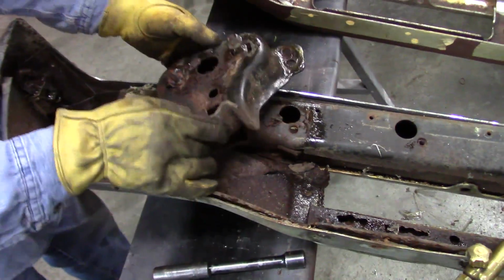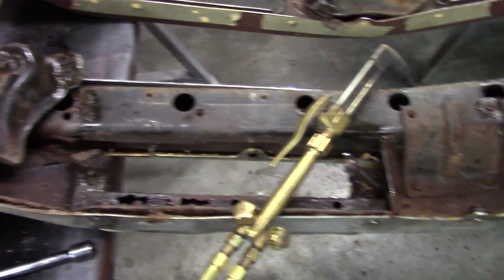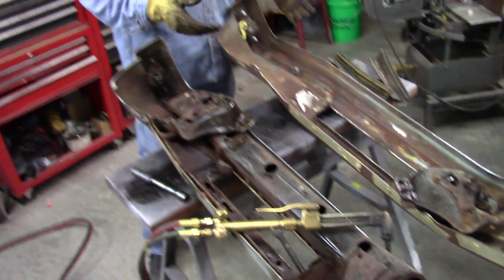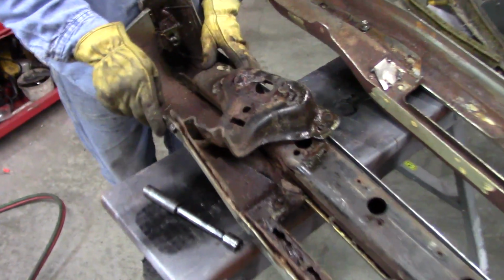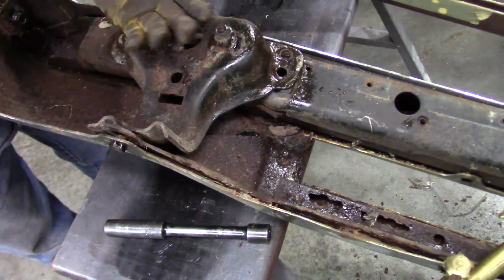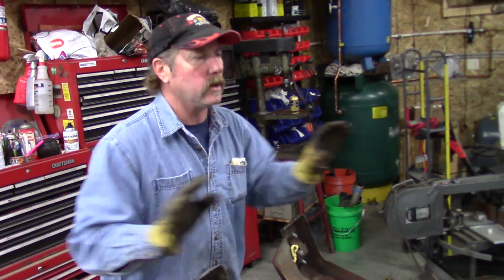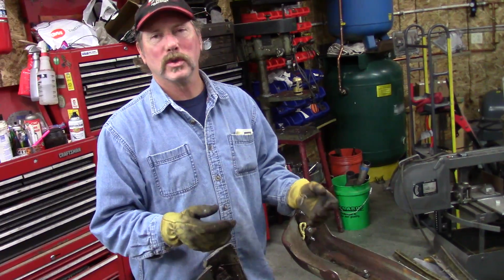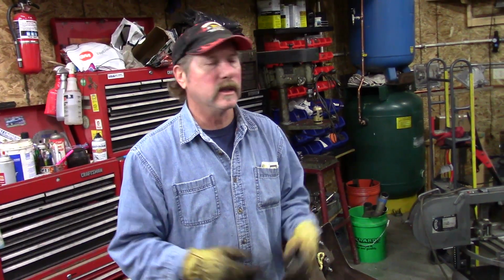So this bumper is like 3/16 steel and you've got the chrome face. That's heavy enough as it is, we're talking this car is wide, it's like 5 feet wide, and then there's another I-beam that they clamped them together, then it's got these brackets, and then it's got these heavy shocks that go into the frame horns, so that when you hit, it would go doo-doo. A lot of people would get in accidents and you didn't think anything was wrong, but once those shocks were impacted, they always said you were supposed to change them out, but a lot of people didn't. Next time you got in an accident, they just went in real quick.